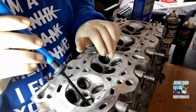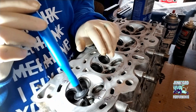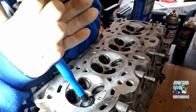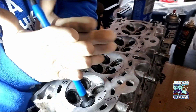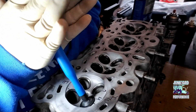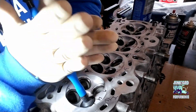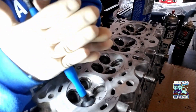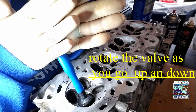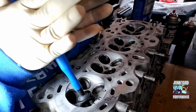Slide it into the seat. When you do this, make sure it's lubed up. Slam it against the seat, and then it's easy as this. Push down firmly — you don't need to bear down on it. Pull it in and out. You want to spin the valve every once in a while.